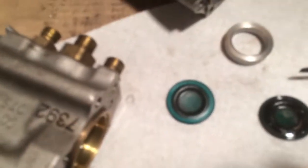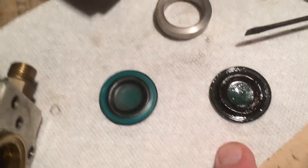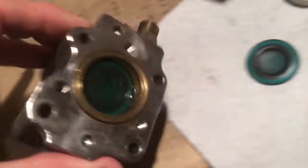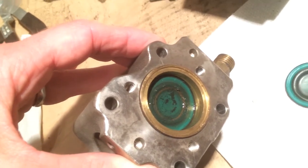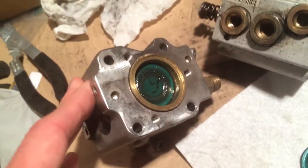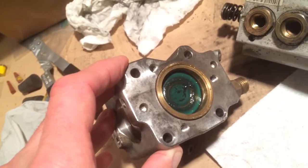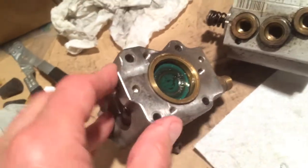The green diaphragm down here will just pop right out. The difference between a healthy diaphragm and a messed up one — this is a healthy one, it came out all in one piece. This is the one that was on my car that failed. It's wet with lubricant right now, but half of it is still stuck in there. The edge is almost dry-glued to the metal, probably because it's been sitting for months. To pull it out I'm having to stick a probe through the center of it and destroy it. The last thing you want to do is scratch the metal edges, so I opted to just poke it in the center and start yanking it out.